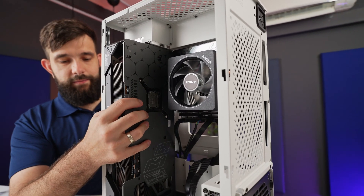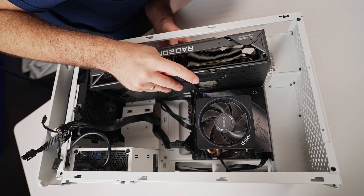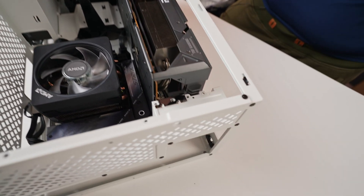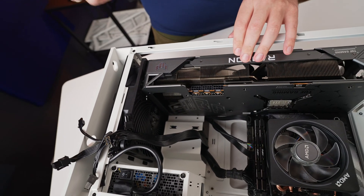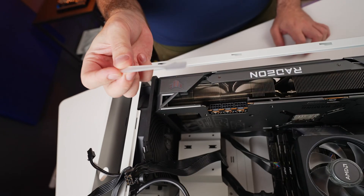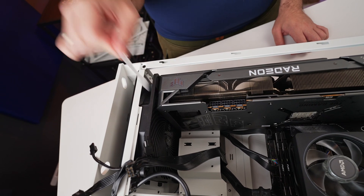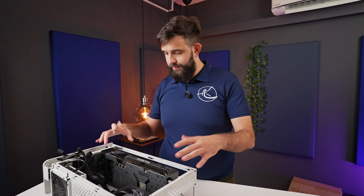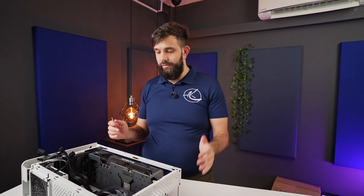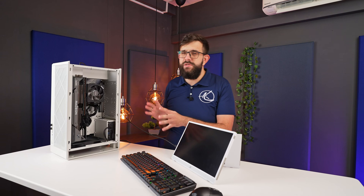It is fitting, but it's just standing on top of the bottom fan right now. This is a very tight fit — to show you how little space there is between the fan and the graphics card, I'm using a really small piece of plastic for the CPU thermal base. It won't go any further in. Because it's a vertical mount, the majority of the weight is on the bracket up here, so it won't lean down and you don't need any special brackets to hold it in place.